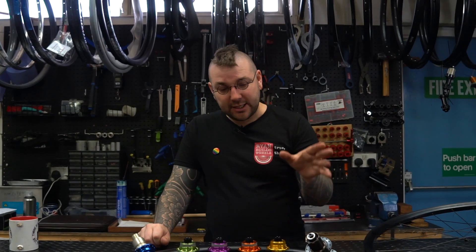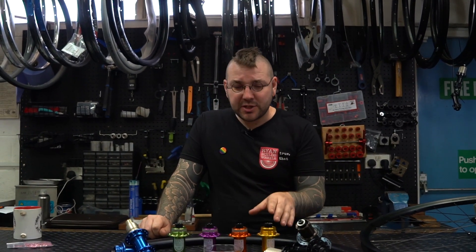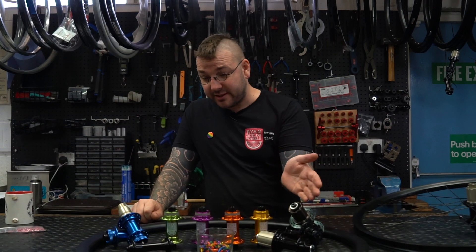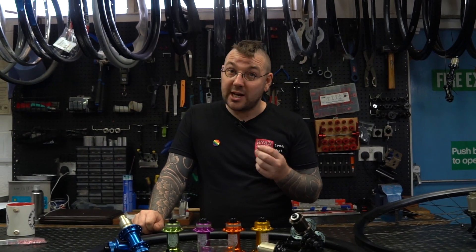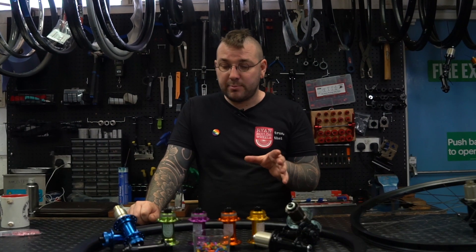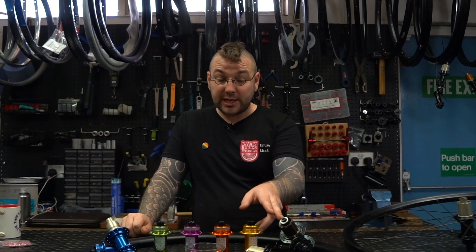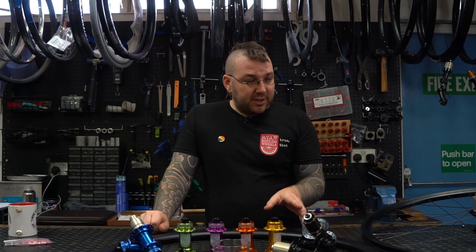Let's start from the middle — hubs. I've been a huge fan of Bitex hubs for years; you can find more about them on my blog. One of my core tenets here at Ryan Builds Wheels is transparency, and you're never going to find me rebadging stuff. I'm not going to tell you these are Ryan Builds Wheels hubs, because they're made by Bitex, and they're really good. They're available in six bolt and center lock with rim brake, lots of different color options, and in terms of tech specs and flange sizes they're very much the wheel builder's hub. Lots of different freehub options, and the freehub internals are pretty clever as well.